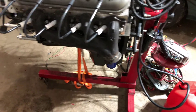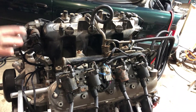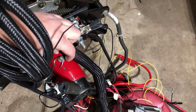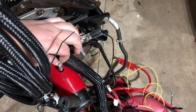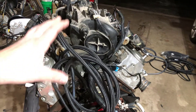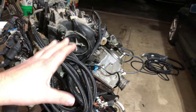For those of you who follow us and watch a lot of our videos, you know we are super serious when it comes to safety. All joking aside, starting an engine on a stand can be a little dangerous, so I really want to go over a few things. First and foremost, I see a lot of people doing these engine stand startups — they hit the starter, the engine cranks over and fires, and as soon as it fires, you see the entire engine rock sideways. The biggest thing is: there is a pin on these engine stands to keep them from moving, but look at how much slop it has. The pin is really, really small, so it gives you a lot of room for the engine to turn before it bottoms out. This engine weighs quite a bit and has a lot of torque, especially when it starts up. If it gets enough rotational force before bottoming out on that pin, there is a very real chance that this thing can flip over.